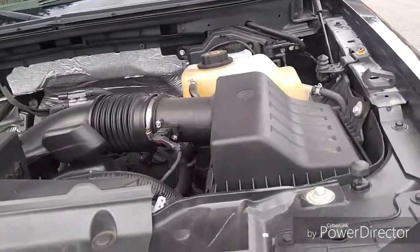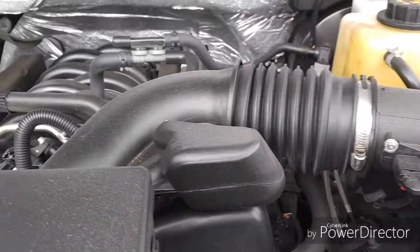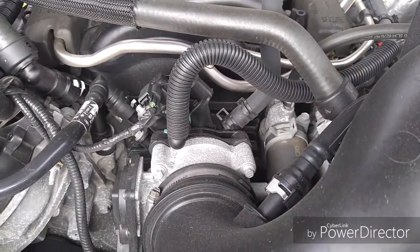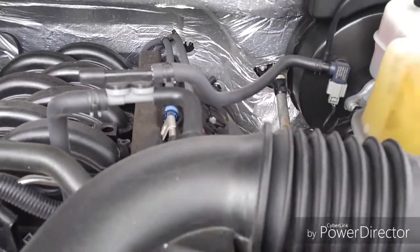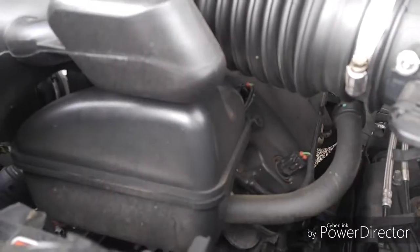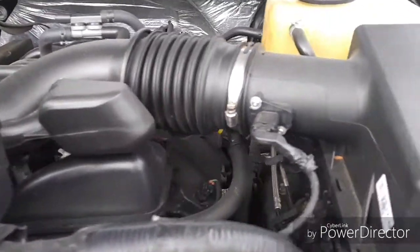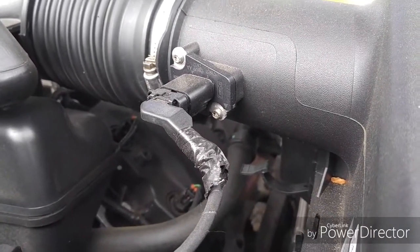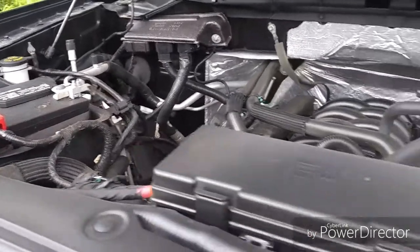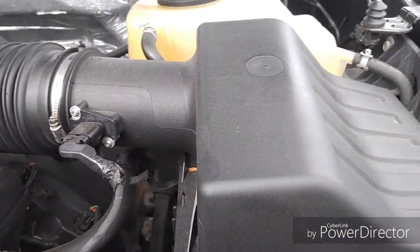This is the inside of the 2012 Ford F-150 — here's the air filter and the housing. Going down, that is where you're going to be connecting to the intake. There's your PCV valve and then you have this other line that you need to hook up as well. Those chambers that make it more silent are called resonance chambers. This is the MAF sensor — the mass airflow sensor — and that needs to be taken out. To do this, you do need to remove your negative side battery cable; otherwise, you could pull a code.